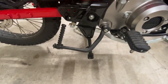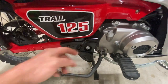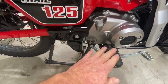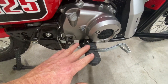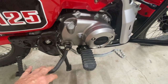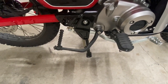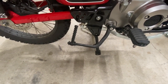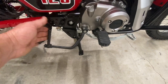Another super easy modification I've done is the kickstart lever. It comes stock turned up, which puts it level with the footrest. What would happen is your foot would try to get on top of the kickstart, put a little pressure on the splines in there, and make a clicking noise — very irritating and a cause for concern. Now I've bent it down and you've got plenty of clearance back there, so unless you're doing some rough riding, you're not going to bother it anymore.